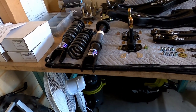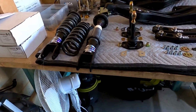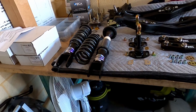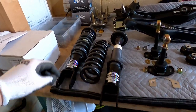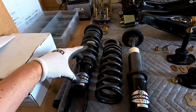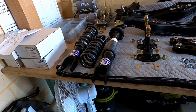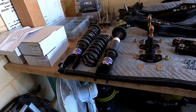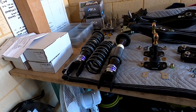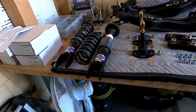I've had a good think about why companies advertise the wrong way of doing it, and I think it's because of the generic nature of their mass-produced suspension. They use consistent shock lengths and spring lengths across many different models, set up so that you install a spring with a spring perch to have the right preload, then adjust ride height using the bottom mount. But that impacts the upper and lower limits of the wheel's travel relative to the car, which is not a good thing. Fine for street use, but on the track, if you're in danger of contacting a tyre on the chassis or body, that could end really badly. I'll go through step by step how that's done properly.